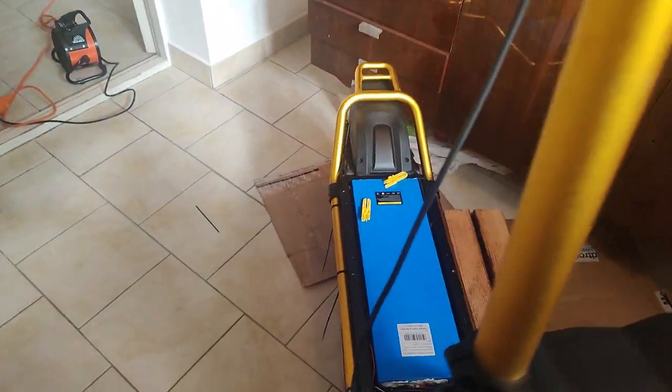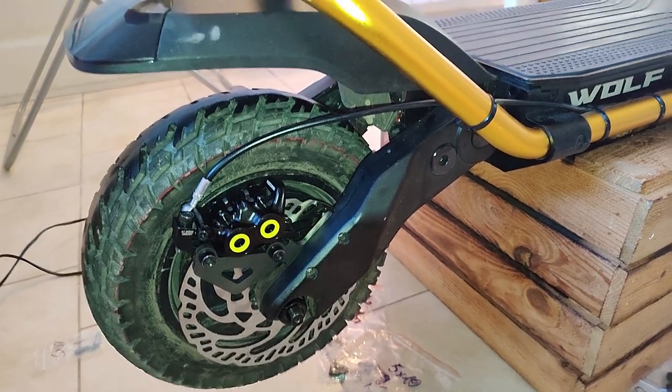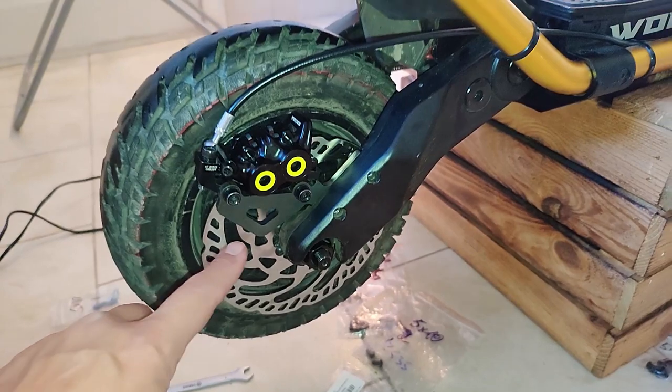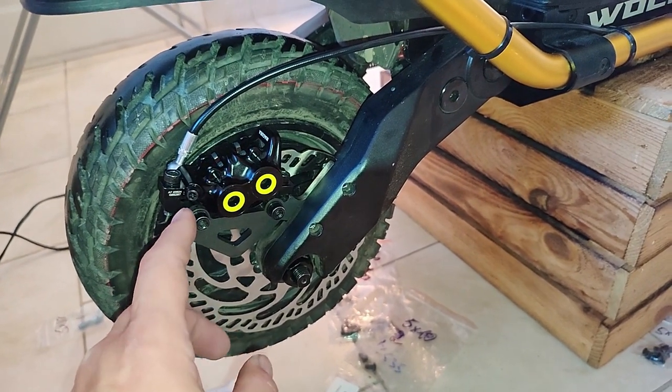And then I cut it, put the white plastic plug in there, and then did my cable running, starting from the back, going forward, and then through the harness and up to the lever. Why that was a big mistake is because now my cable is too short. You'll see from the videos and the photos that I ended up having to pull it pretty tight in the front.